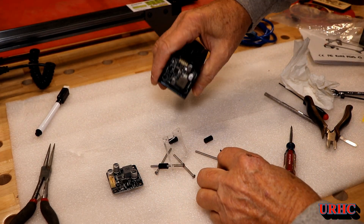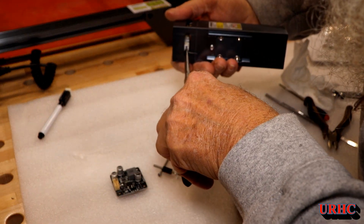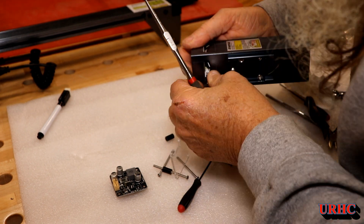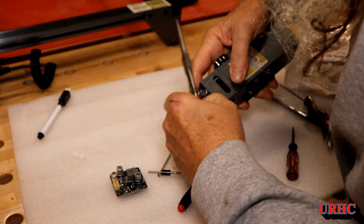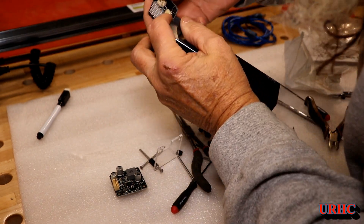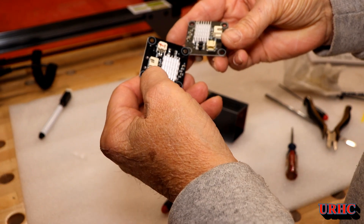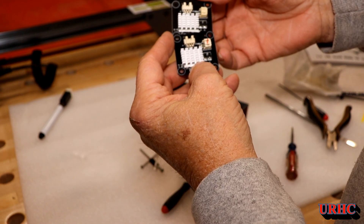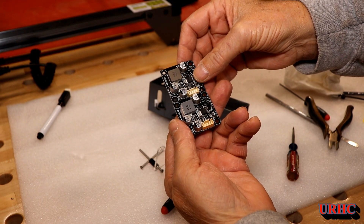It's pretty simple - you take out the four corner screws which go way down into the laser, then take that cover off. There are two layers of plastic spacers, and then you have to unplug the connector to the laser and one to a fan. I had to use needle-nose pliers because my fingers wouldn't fit in there. The fan comes out and there are some more spacers, and that's how the board comes out. It almost looks like the same board they use on the Xtool lasers. The old board had no coating on it; the new one looks much higher quality with a nice conformal coating.